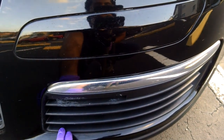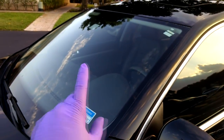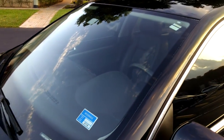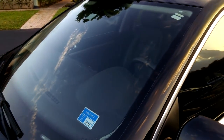Remember, you want to tape off all of your black plastic down here, down here, everywhere. When getting to the windshield, I like to tape it up on the edges first, then I like to take a couple of really cheap garbage bags and tape those on top and make a seal with those garbage bags.